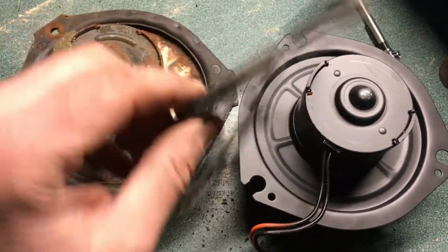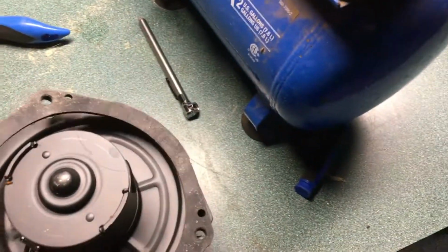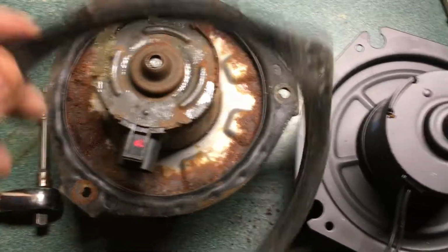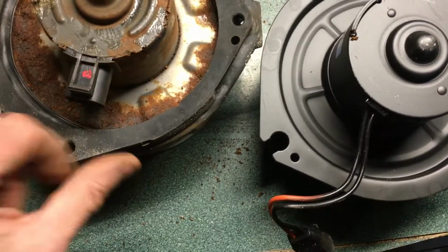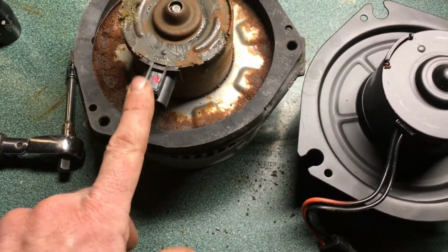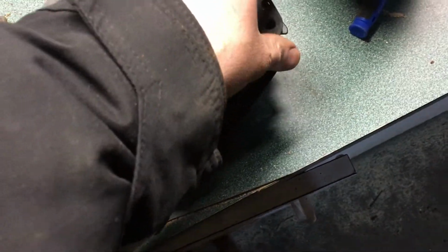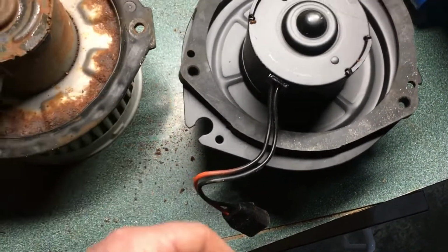Okay, so another tip I'm figuring out, and I'm just looking at these. I was trying to get the rubbers on, but these are not equidistant apart. They're actually a little bit different. So my motor from my car sits like this. This gasket only sits one way, so that the holes line up. So note to self, make sure you get this lined up. This was pointing towards the car. And so I should be able to just transfer it this way, and it will match up again. I'll put my rubbers on, but I gotta make sure that the plugs both point in the same direction. Otherwise, getting this thing on is gonna be tough.